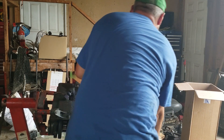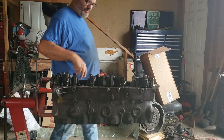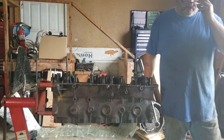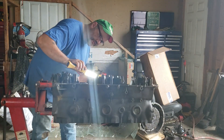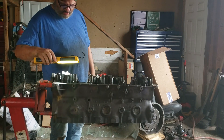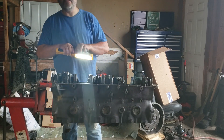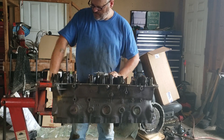That's a good tight engine. Going to torque these down, put the oil pump on, and I'm done for the day. All 33 ft-lbs all the way around. Let me check — one, two, three, four, five, and six — all the numbers match. Pistons are all pointing in the right direction. Everything looks good — I double-checked the mains. The crank is now in, the new oil pump is on, the gasket's on.